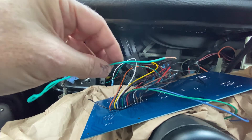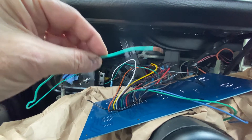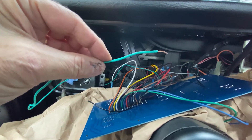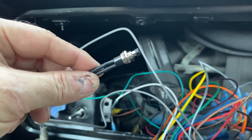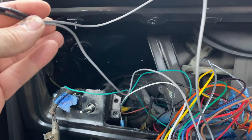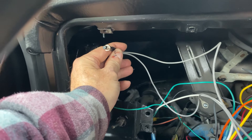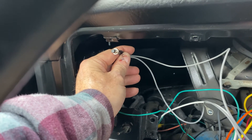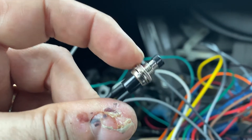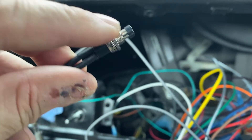The previous owner was nice enough to run a steering wheel tach wire back from the tachometer, so I've got that wire already. If you don't have one, you're going to have to run it over to the tach under the hood. I want to make note of this — this is essentially the programming button for the dash kit. I've seen a lot of guys put them right in the dash — pop a hole through and bring it through. It's got a little nut here to hold it on. It doesn't look great but it's very small.